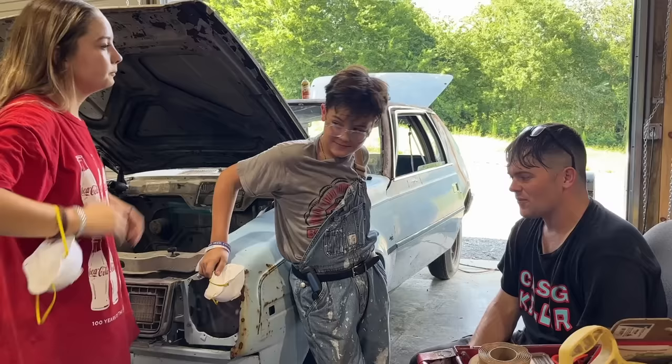I'm going to try to measure out the center of these holes and drill them in the firewall to mount this thing. Looks like it's 2.25 — two and a quarter inches center to center. There's a huge weight difference in those master cylinders — the old one weighs ten pounds, the new aluminum one is less than one. Ten times lighter. I'm going to get this hood out of our way. It's probably not going to have a hood after the engine I'm putting in it. We've barely got enough metal for those two bolts.